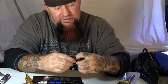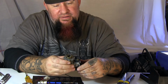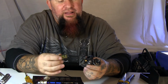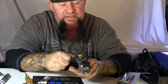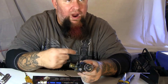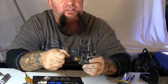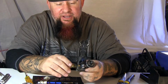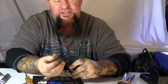At this point, that's top dead center, so I'm not going to get any higher with that, but it pulled out. Had it not pulled out as smooth as that, some people have taken flatheads and pried on it. I never agree with prying on a sleeve. I will wrap the exposed part of it with tape, hold it with channel locks, lightly churn, and work it out. Never force, never pull, never yank on it. This is just brass, because sometimes all you have to do is take these parts out and clean them.